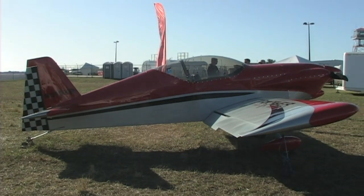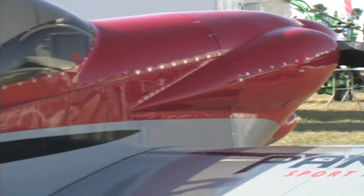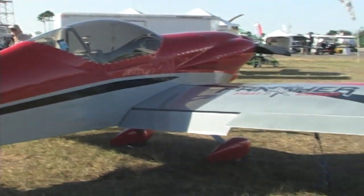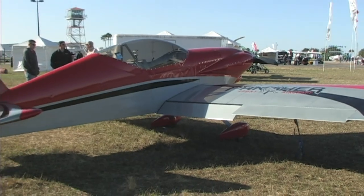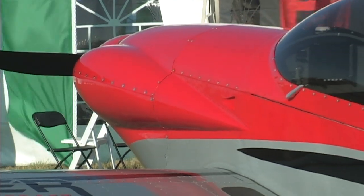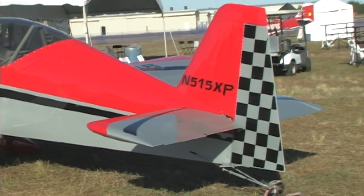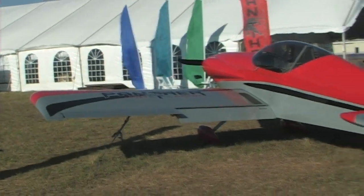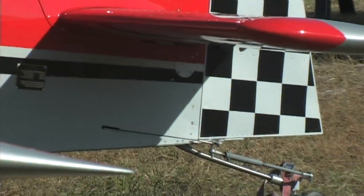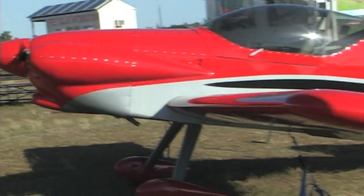ISA stands for aerobatics. Are you doing aerobatics currently with the Corvair? Oh yes, absolutely. Currently positive-G aerobatics — it's stressed for positive 6, negative 4.4. We do low-energy snapping maneuvers like the snap roll on top of the loop, hammerheads, and spins. We've played with some inverted flight but the engine quits pretty quickly. We do sportsman-type aerobatic maneuvers really well, and we're going to play with a longer aileron for guys that really want to do sportsman-type stuff to get the roll rate closer to 170 degrees per second — it's about 150 now.